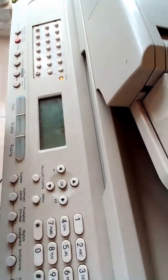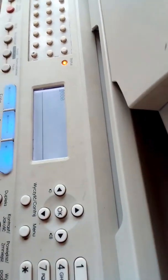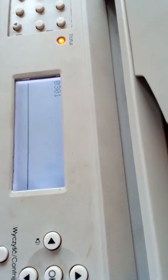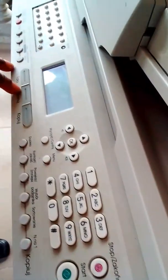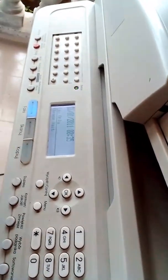Okay, it's done now — the Please Wait is over. Now you type in 74, and it shows 0000. So you come here and type in 0301. Once you type in 0301, you click the Start button. And the two other keys — the fax and the scan button — begin to function. After you're done, you switch off the machine, then switch it on again. By the time you turn it on again, you realize that the previously non-functioning keys will definitely start functioning.